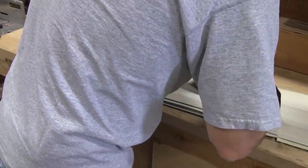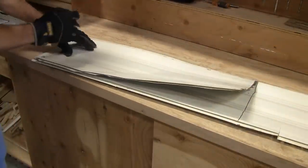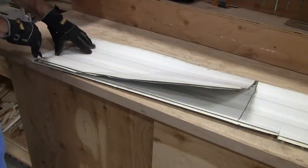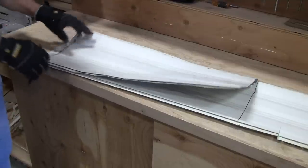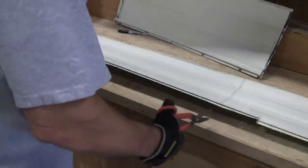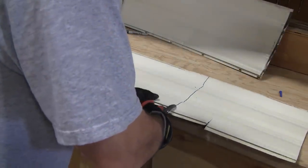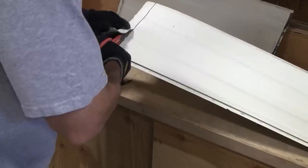We use the piece of siding we removed as a pattern to make the new piece. Tracing it with a Sharpie works well because the ends will be covered with trim. I use regular tin snips, but you may want to use the appropriate aviation snips for cutting a tighter radius.